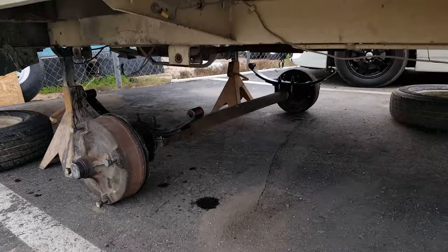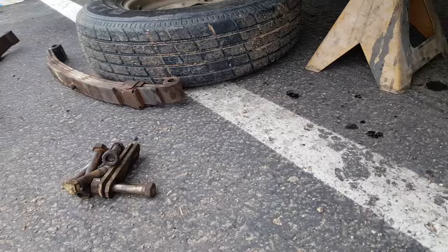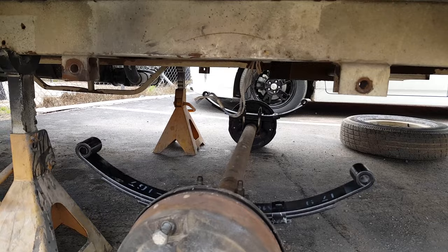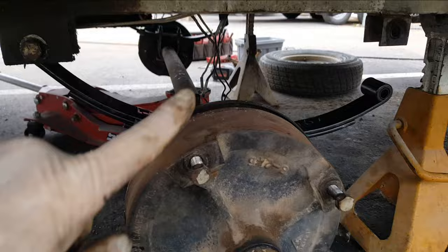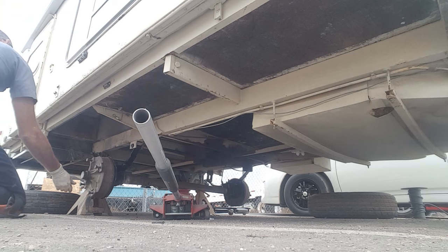I dragged it back over here - now I just have to put it into place. That's going to fit in the hanger up there, and then there's a shackle right there, so those go back there. I normally just put a jack in the middle and jack the whole axle up at the same time. Obviously you don't put any pressure on it, it's just supporting the axle as you manhandle it. It's always a good idea not to tighten these up until it's completely installed, because you want a little bit of movement so that you can line up those hangers. I got that bolted on and all the other bolts on - just got the last leaf spring and shackle to put on, then tighten everything up.